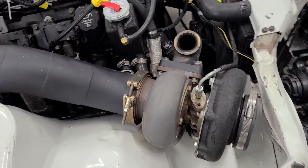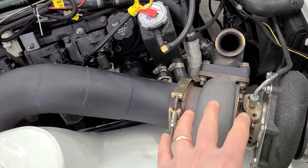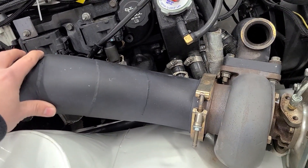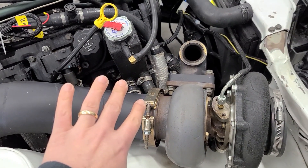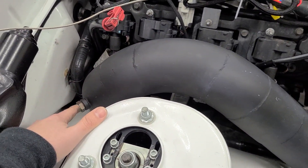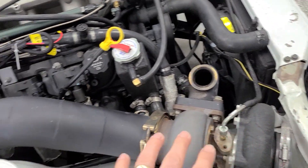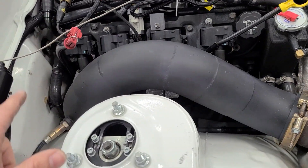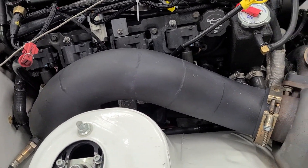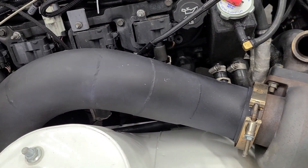Before I can pull the turbo off, this downpipe - if I take the turbo off, the downpipe kind of flops around and can move. So I need to make a bracket to hold this downpipe rigid so I can pull the turbo out and the downpipe will stay right where it's at while I figure out how to fab up the new turbo mounting. The clearance is so close to the frame rail and the starter down here that I don't want it moving at all. I'm afraid if I just go tearing the turbo off, I'm going to screw up that clearance and have more issues with the exhaust rubbing the frame rail, which I've already resolved in the past. So I need a bracket to make this downpipe rigid - that's what I'm working on here.